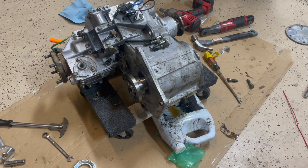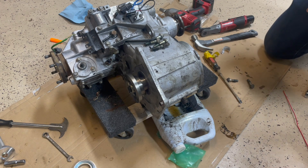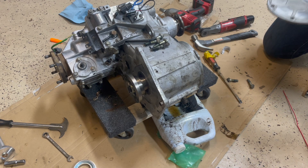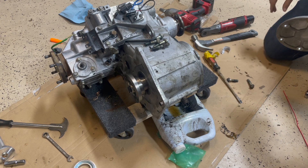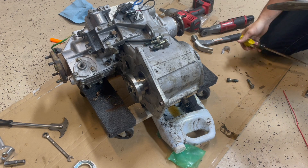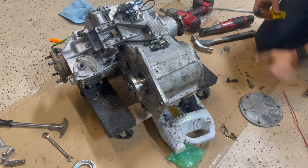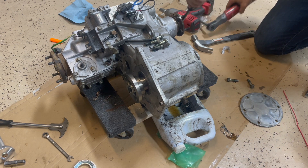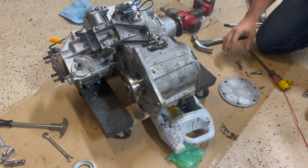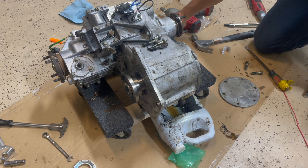While I was off camera, I tightened up the nut on the front. I put the backer plate on for a little bit to give it some space so that it wouldn't keep pushing off when I put tension on it. I locked the center diff and then just ran a screwdriver in between two of the studs in order to get it to hold solid. I'm going to tighten this up - I cleaned this off and I'm going to throw some new RTV on it.